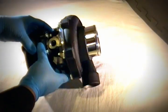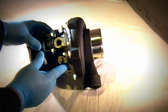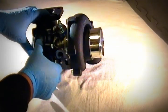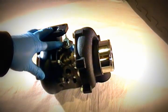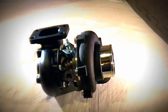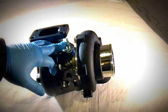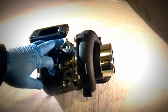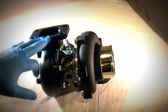We have our standard T3-T4 discharge for the oil return. Please try to avoid using 90-degree fittings with this because it could cause an oil backup. Up here you'll notice this uses a 1/8th NPT thread pitch for the fitting. There's actually a restrictor on this particular one, and a lot of people ask whether a restrictor is needed. Some say because it's journal bearing it's not needed, and with ball bearings you must use one. I say always look at oil pressure at cold start, especially with Garrett cartridges. For this type and style of Garrett cartridge, anything over 75 pounds of oil pressure at cold start is going to require a 0.060 to 0.065-inch oil restrictor — no smaller, as you don't want to starve the cartridge. This particular one is a dash-3, and there are dash-4s available for those that want to use an inline oil filter. Anything over 75 pounds of pressure, please use a restrictor.